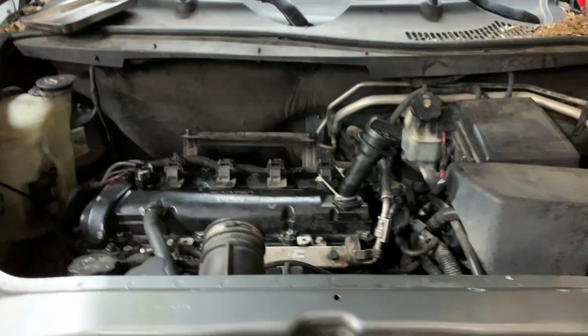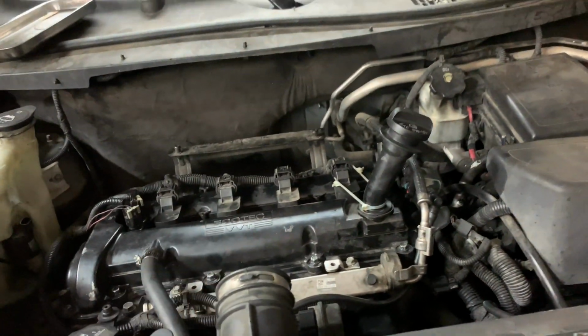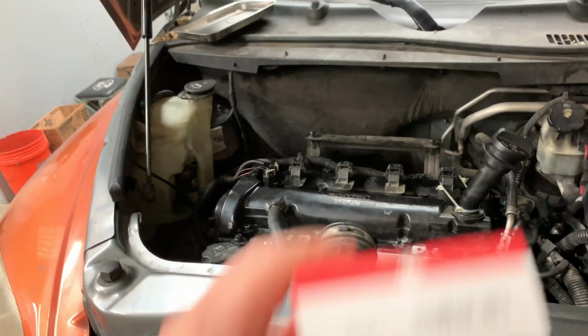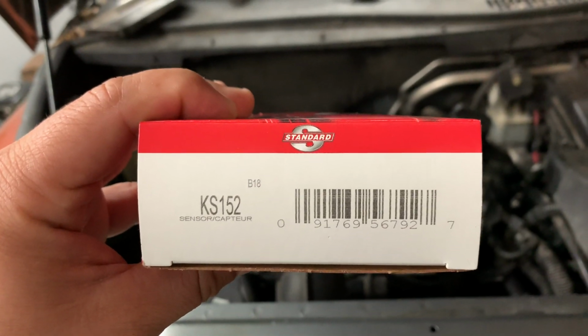All right guys, so here we are. This is a 2006 HHR Chevy with a 2.4 liter Ecotec engine. We're going to be replacing the knock sensor to fix the code P0327. This is the part number right here, Standard part KS152. I'm going to put a link right there in the description.